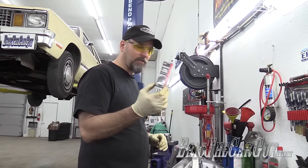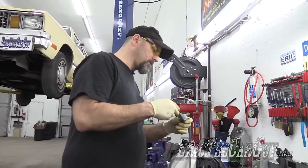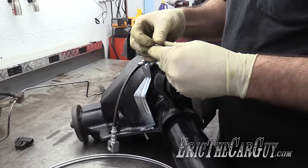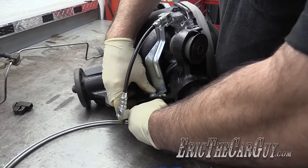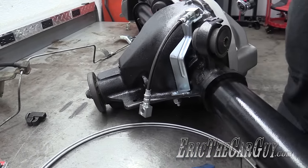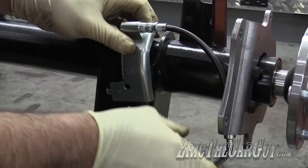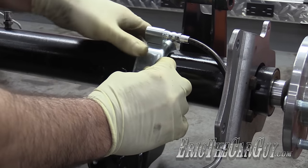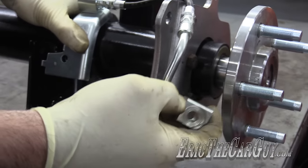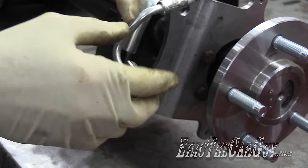And this is what kills you on these builds — it's these little things that you have to run to the store for that cost you time and money, that quite literally nickel and dime you to death. I'm going to start by mounting our central location here. Turns out it's 17 millimeter. This car is going to be sort of an amalgam between standard sizes and metric, weirdly. It's like it was made to be there. Now that I have the central point mounted, I think I'm going to mount the outer points as well, so that way I can just come in and run my lines. I'm going to go grab one of the calipers real quick just to see how that looks, because it making contact here doesn't excite me all that much. I want to make sure that when the caliper is finally mounted on there, that this is a good position.